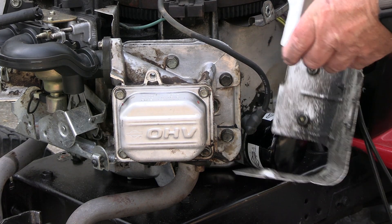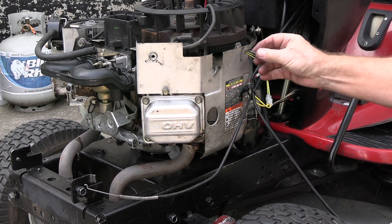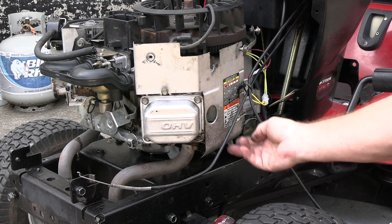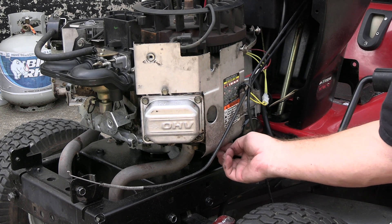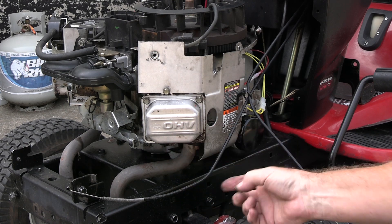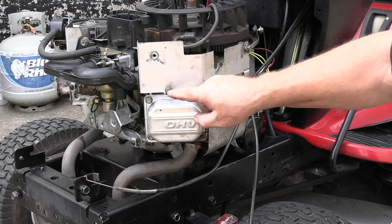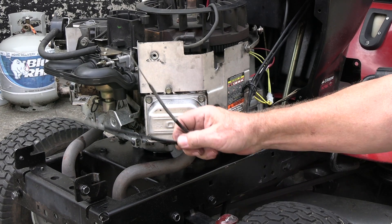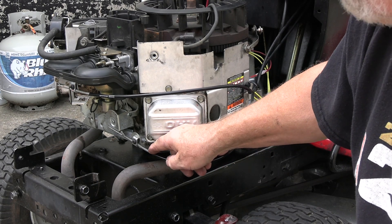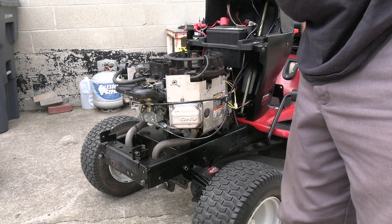Now I'm going to go ahead and slide this up on there. Get your bolt in here, put a little bolt in up here. Get this started — that should give you a good area to start with when you line this bolt down here up. Remember, it's an 8mm head because this one here goes right up under here. Everything's hooked up. I'm just going to tighten that down and hook these up. All you do is push your choke all the way in and push your throttle all the way down, relax them down, and then lock them in. I'm going to put the spark plug in here and see how it starts.